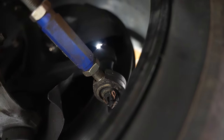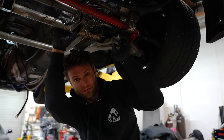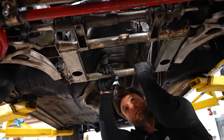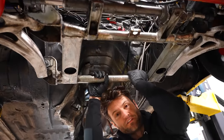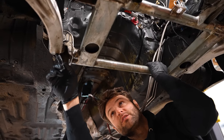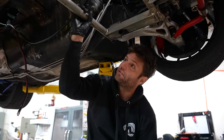You also have the same thing going on down here. If the steering rack was able to move up, you eliminate a lot of this mechanical leverage. All of that comes down to the jungle gym right here that I'm holding on. This bar is now in the way, and it is a very, very important bar — it is holding the suspension lower control arms in place. We have a bigger engine and we have a lot more force.